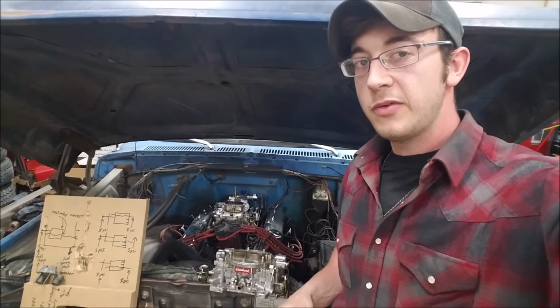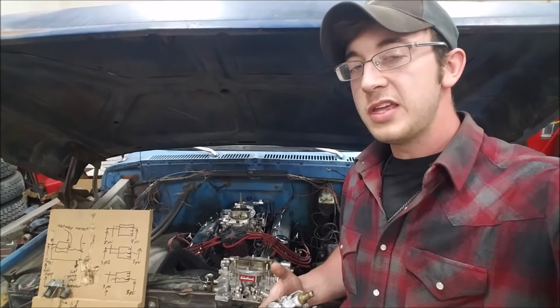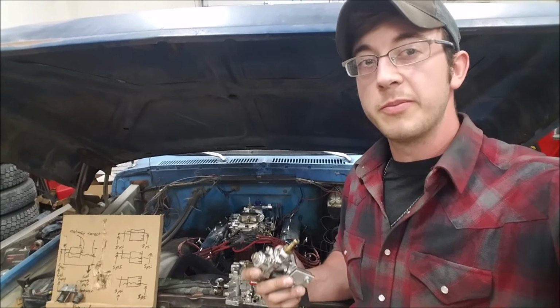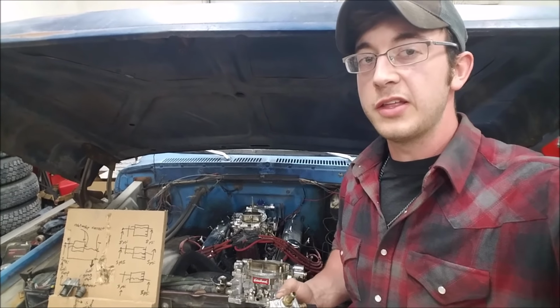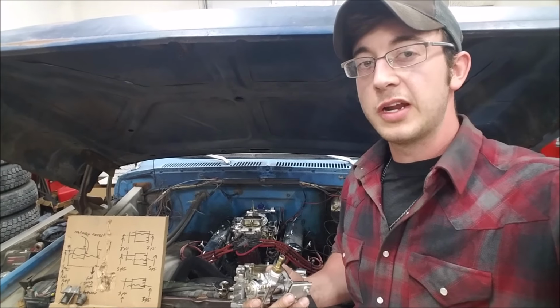In our other video, we talked about Edelbrock carburetors specifically. You can't see the fuel level in the float bowl, so you want to be very specific with where you set that fuel pressure. These are extremely important with an Edelbrock, and if you have variability in your fuel pressure, even with a Holley, you do need to run a regulator. These are the ones that I like, and I'll leave a link below to the gauge that I prefer too.